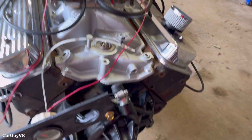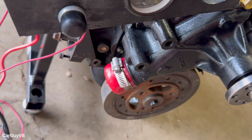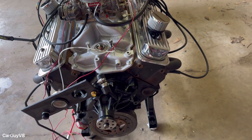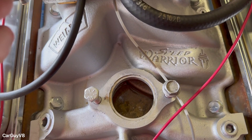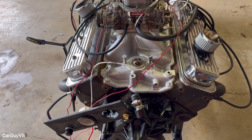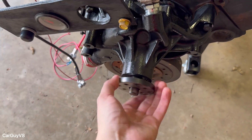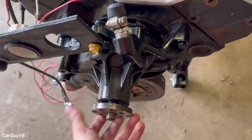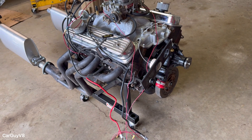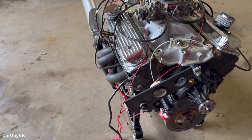One thing I like to do is take a torque converter cap — they're like $7-$8 if you don't have one — and cap off the bottom of the water pump. That way you can put water in the block so there aren't air pockets inside the cooling passages in the cylinder heads and block. It's always wise to put some water in there, and you can spin the water pump after you run it. This should allow you to run it for roughly 45 seconds to a minute without causing issues, because you will have coolant in the head — it's just not circulating — so don't run it long.